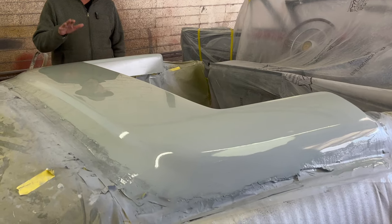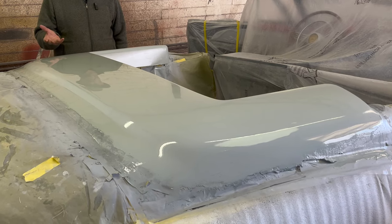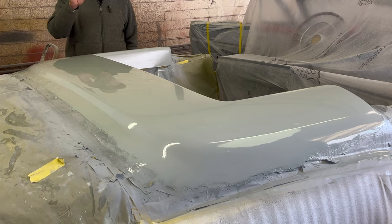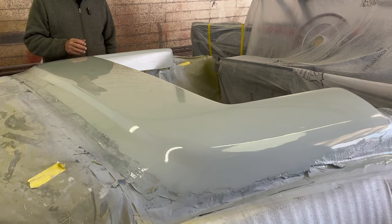Is this like a normal paint on it right now? This is a filler primer that we put over it because it's viscous. The first layer was sprayed and sanded, and then the second layer you just spray. If you've got a good finish — we've got a pretty good finish here. If we're not absolutely perfect, it can be addressed on the part, but we really don't want to do it that way. So we've got a very nice finish on it. We'll make the mold off of this — spray black gel coat on it, let that dry, lay a fiberglass behind it, then another layer of fiberglass, and then we'll pop this off. This will be thrown away. A part will be generated from the mold — so you've got male, female, and then back to male again. Then we'll finally fit that to the car, trim it, and send it off to the paint shop.